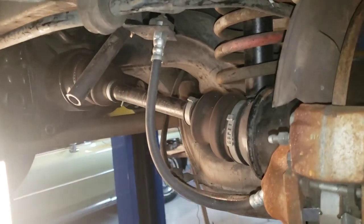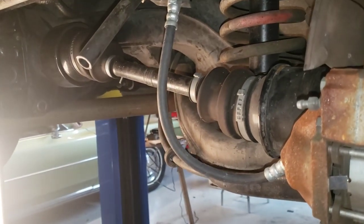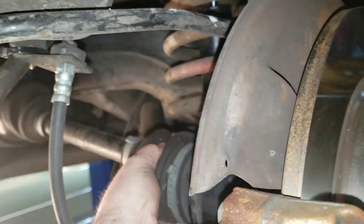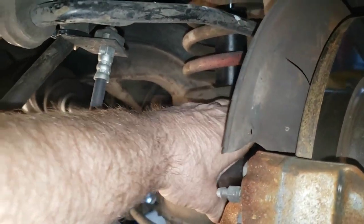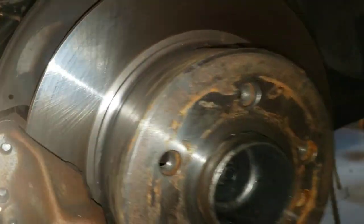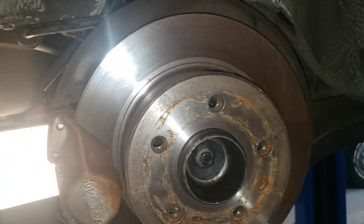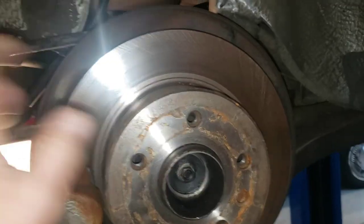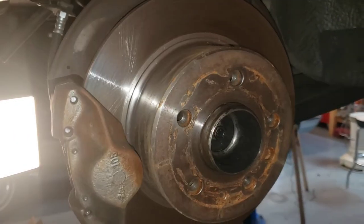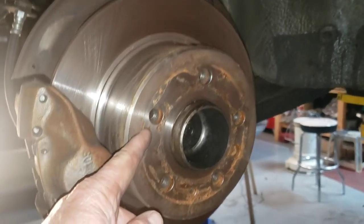Because you may recall that we rebuilt those a couple of years ago, and they still look good — dry and whatnot. When I turn it I don't feel anything there. This sounds like a wheel bearing, unfortunately. Let's hope there's some gizmo that's fallen off the emergency brake or parking brake and it's rubbing and just being ground down inside there. But unfortunately that doesn't sound too positive to me — I think that's probably a wheel bearing, and that is a whole bunch of work.